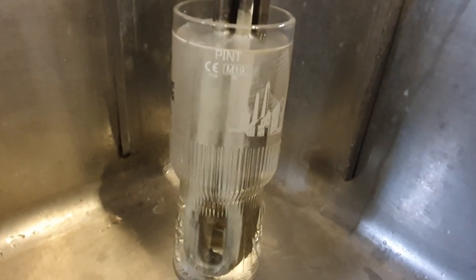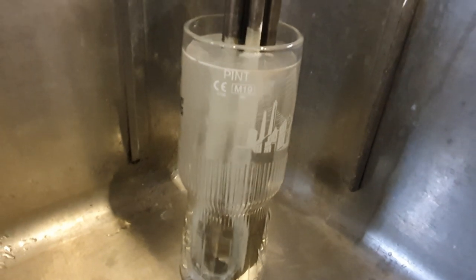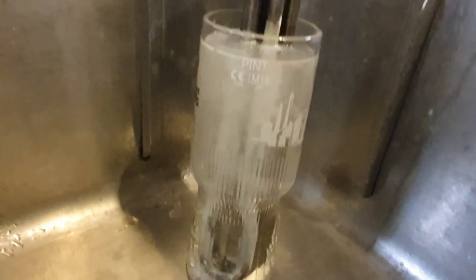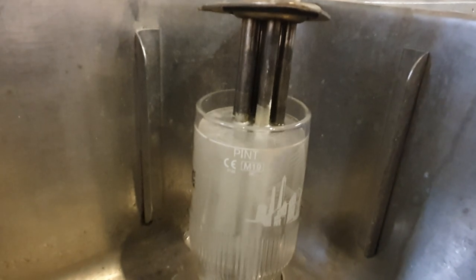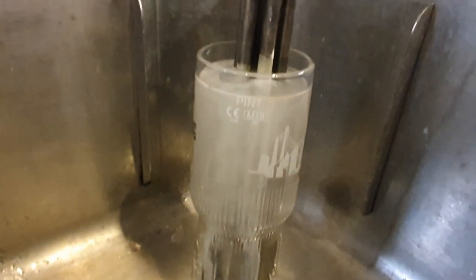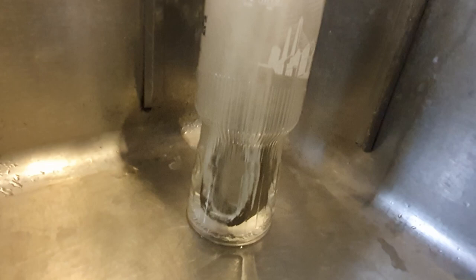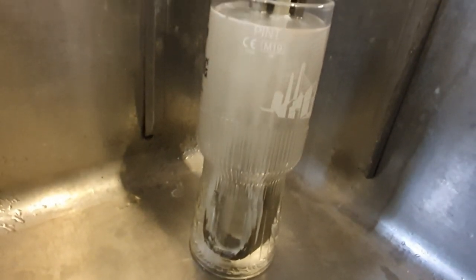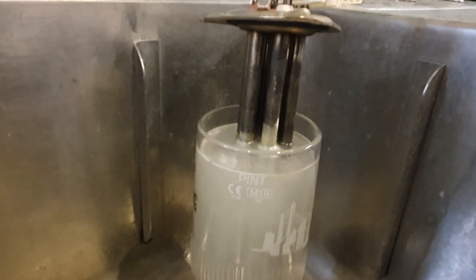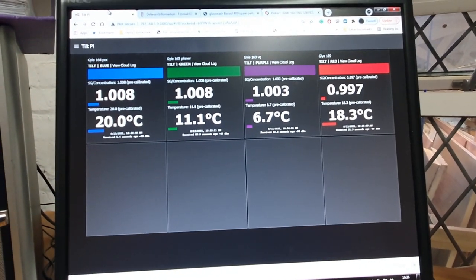There's definitely a good reaction going on, and it shouldn't be eating the steel — nitric acid is quite safe on stainless steel. This isn't a soft metal element; it's stainless, not copper or brass. I'll let it work on the limescale for about 20 minutes and may just top it off with a bit of water to cover that top section.